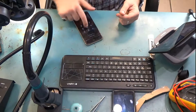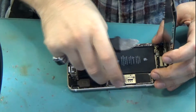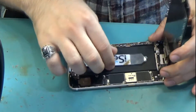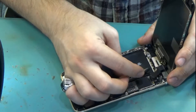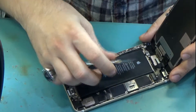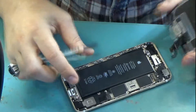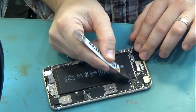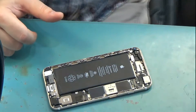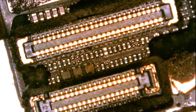Touch is not working. The first thing we have to do is disconnect the battery, which is right over here. Battery is disconnected. This is where the screen connects. Just gently, from the surface, we go under the connector and pull sideways. Now if you're not careful, you can easily rip components from under the connector, and these components are extremely tiny — they are the SMD-01005 components, microscopic. Let's take a look under the microscope. Right off the bat, I see a missing component.